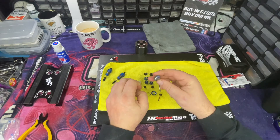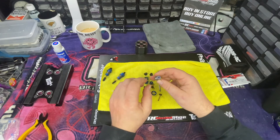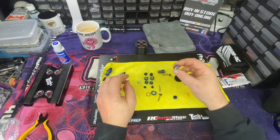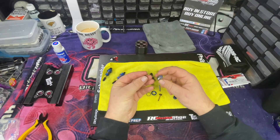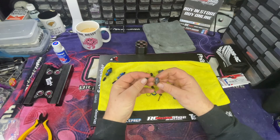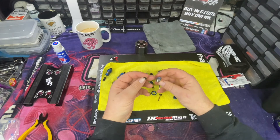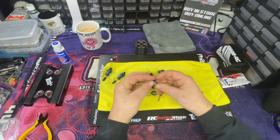It's not there for lubrication, it's there to protect the O-ring. The only surface of the O-ring that should be touching the shock shaft is the very thin inner hole there. Then obviously you put your shock guide. On these shocks — I think these are Yokomo DRB or DIB shocks — they come with this thicker shock guide and just one O-ring specifically for drifting. Some of the older touring cars will have two O-rings and a thinner shock guide.